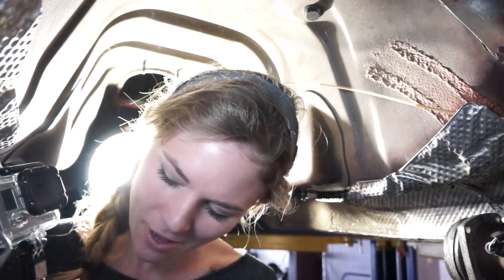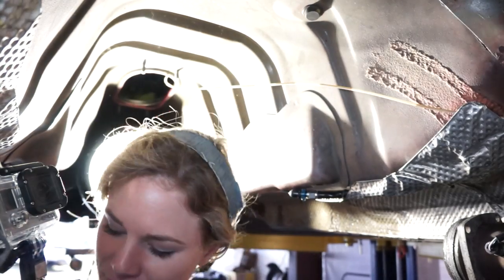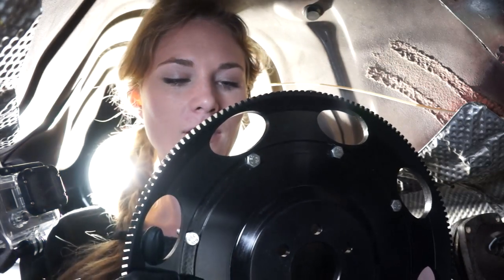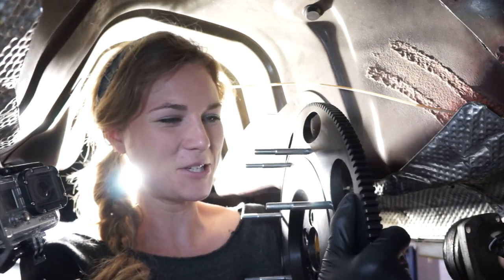Mantic Clutch has a YouTube channel with an install video, which I watched probably four times — the last two because I like the guy's accent. It's made in Australia, of course. The assembly is quite cool the way it works. The bolts push in from the backside of the flywheel. I already put my bolts in because they fit tight — I tapped them each in to fit tightly in this channel to keep the bolts from turning. So they act as studs, which you build your clutch onto.